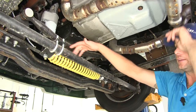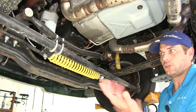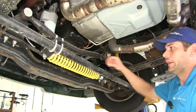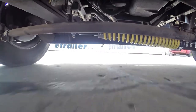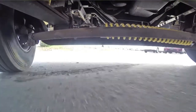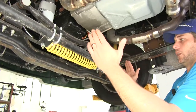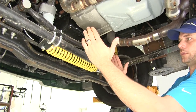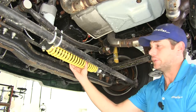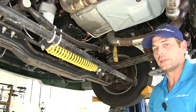There's also a heavy duty coil spring in the steering stabilizer. Right now it's pretty relaxed with no tension on it. If we hit a rut and the tire wants to pull that way, it's going to stretch that spring out — the spring tries to pull it back to center. Same if it goes the other way: the spring compresses and fights to get back. It connects between your tie rod and the axle, so as we head down the road, that spring is always trying to stay in its neutral position, keeping us tracking straight. This is a very good upgrade for driver fatigue — putting on a steering stabilizer gives a noticeable difference in handling.